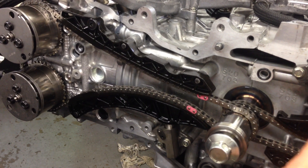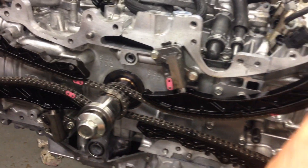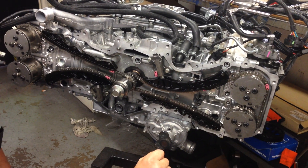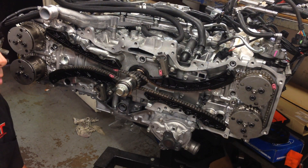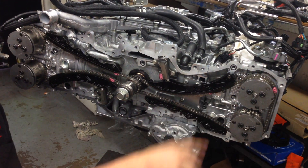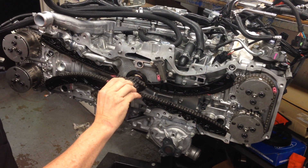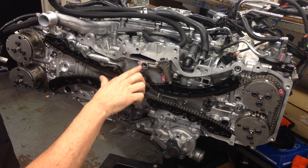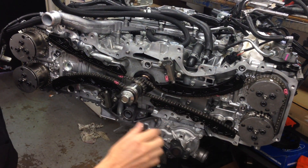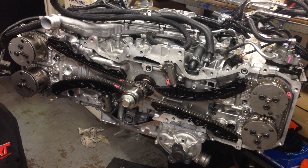Whilst we've got this apart, it's a good opportunity to see how it all works. You've got a cam chain tensioner here, another cam chain tensioner here, and the two chains that drive the inlet and exhaust variable cam control. Inside here is a lot of delicate parts that you need to be aware of if you're doing an engine rebuild — possibly with a damaged big end bearing that can get full of metal particles, which long term will cause problems from an oil pressure point of view, because it's fed by oil pressure from the engine. You'll remember we spoke about the timing cover that goes to the front here, which this part drives — the oil pump that then feeds these oil pressure galleries and O-rings into the engine, and then for the rest of the oil pressure to control the variable cam control, and of course the vital oil that goes to the cams, the cam journals, the crank, and also the bottom of the engine everywhere else.